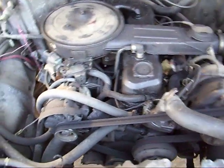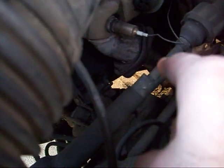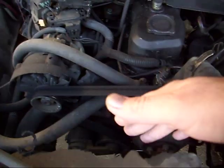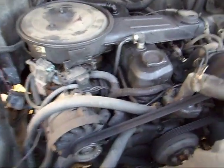When you pop your hood, you're going to want to take off your exhaust manifolds or they'll be in your way. You're going to want to take off the front of the engine — your alternator, power steering, all that, your fan. Go ahead and take your radiator out so that you've got room to work with. Unhook your fuel lines and your electronics.